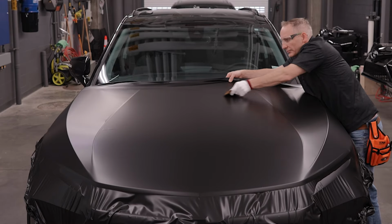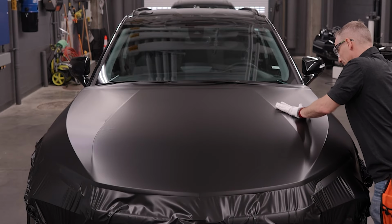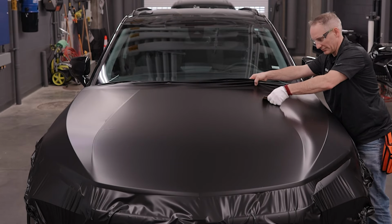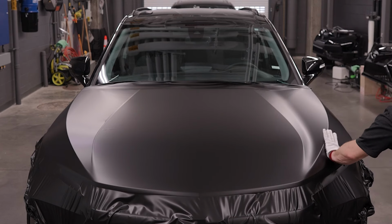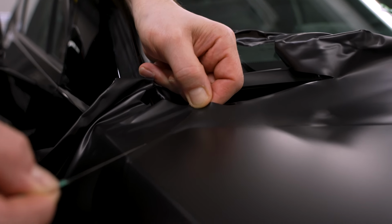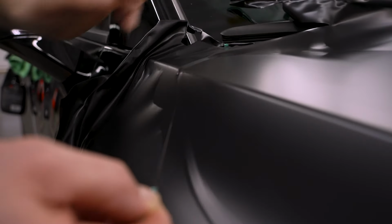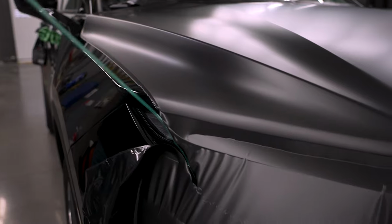Move carefully in a linear direction while applying steady pressure. For slightly recessed areas, use your palm to press the film towards the open area, then squeegee the remaining sections. Palm the edge of the hood and repeat the process on the other side. Press on the 3M Knifeless Tape, pull the line to the edge, and slice by pulling the filament. Remove excess film and carrier.